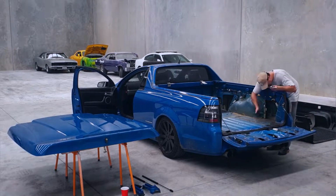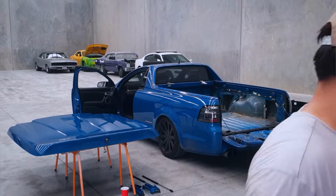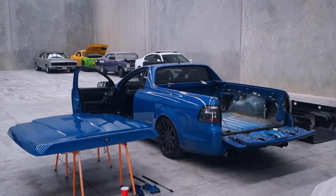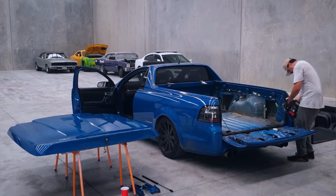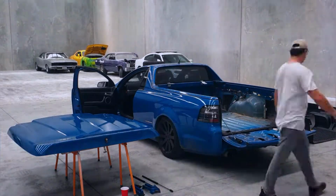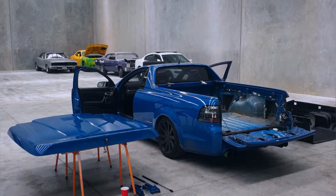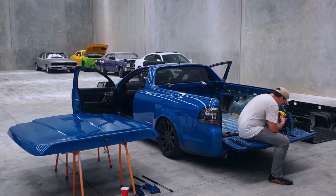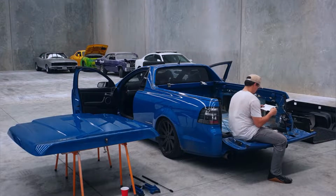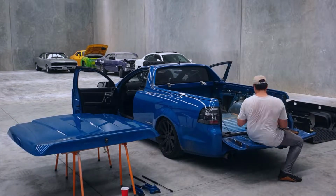So here you'll see me just releasing the rear driver's side tail light, and what I'll be doing is testing the wires to see which one's the positive and which one's the negative. So I use my multimeter for this, and this is just to make sure that the signal wire for the auxiliary camera unit activates once it has that power running through that part of the system. So it lets it know to turn on, and that's all I'm testing now there with the multimeter.